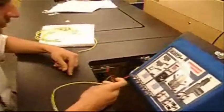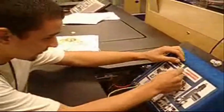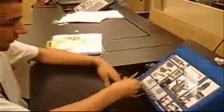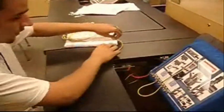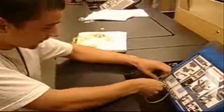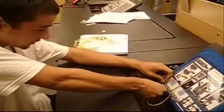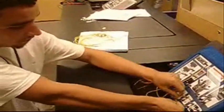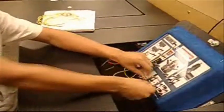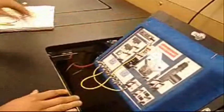So your first step — what are you going to do? I'm going to connect the remote to the power source of the relay, which would be 85 or 86 — the coil. And then ground my relay, and then it should turn on when I turn on the radio, which it does.